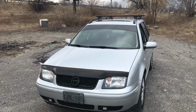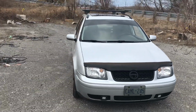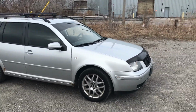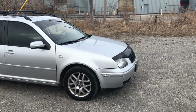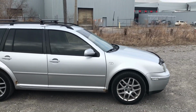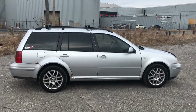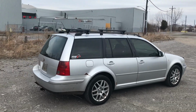My fuel mileage is back somewhat now because the intercooler was replaced and the boost leaks are pretty well gone now. I had a lot of boost leaks with this car, and I stopped looking 6 months ago because I just stopped caring. I had just decided, screw it, I'm just going to get new boost pipes and an intercooler, because I'm pushing almost 22 pounds of boost. It's a stage 2 tune, and it's definitely pushing it more than it wants to be pushed with the factory boost pipes. So they're replaced now. I just need to replace the one clamp.